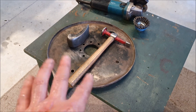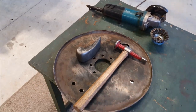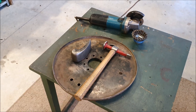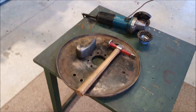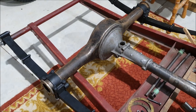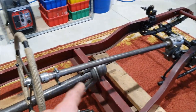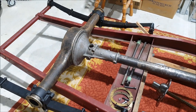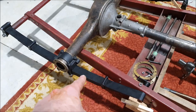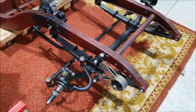For actually painting things like the back plates, they still need a good wire brush or to go through the blaster. I started cleaning up the edges a little with the hammer and dolly, but nothing too serious - I need to press them flat again. Before I paint anything like the rear axle, I've actually got some phosphoric acid solution coming, which will be much better for just cleaning all this stuff up. Same with the steering column, and then I can paint those things. For now I'm just going to keep going and paint everything with the black engine enamel, because it's a nice thin coating. When I decide what I'm actually going to do with the car, it'll be easy enough to remove or paint over.